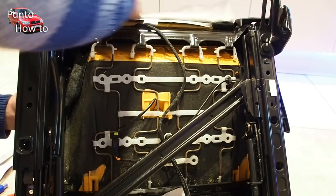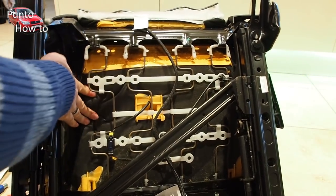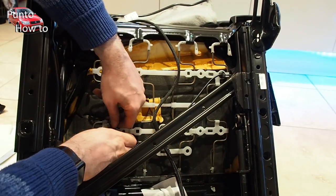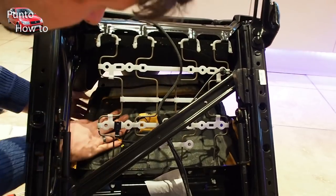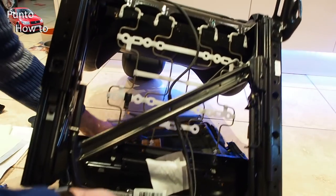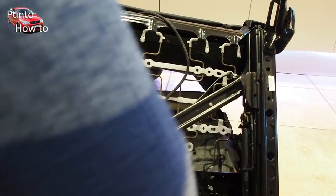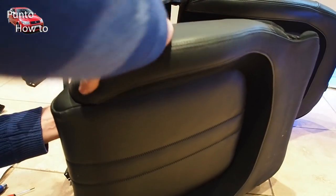Once we have unhooked all four of them — and taken probably a couple of inches of skin off the back of our knuckles — we can start to tuck the seat out of the way. I can now push the fabric or cushion away from the metal base. Being careful not to damage any wires, I just gently pull the foam away from the metalwork. It's hinging on the front of the seat base, so we need to unhook some plastic clips along the front of the underside of the seat. Pulling the cushion forward lets you get these a little bit looser so that you can unhook them from the front of the seat base.